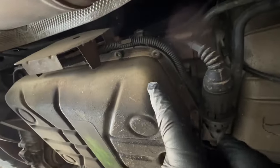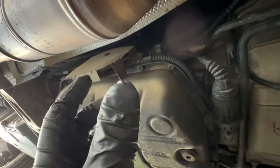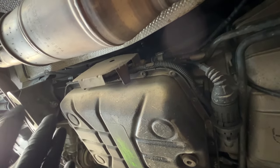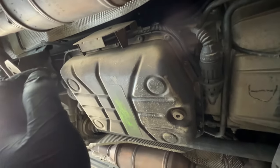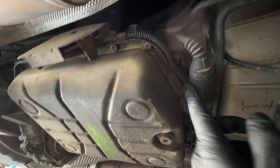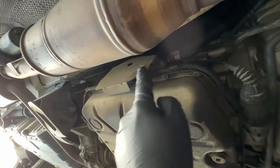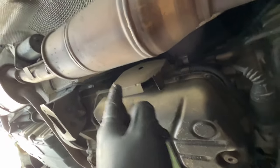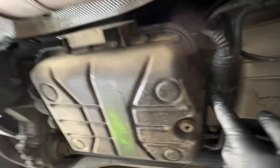This is the oil pan, and this is the view from under the car — that's the exhaust. You have all these little T27 screws around the pan. I like to loosen them by hand rather than using a power tool, just to get a better feel for whether any were previously loose — especially since I don't know the full history of the car. You also have some cables here you clip out. I'll take off this shield — it's a 10mm on both sides — because these hooks will prevent you from removing the pan and accessing some of the screws.